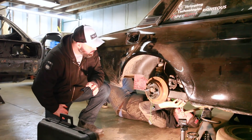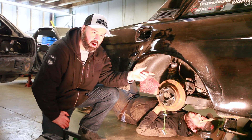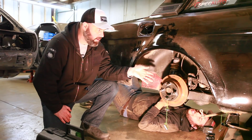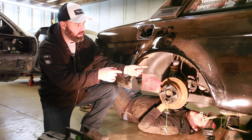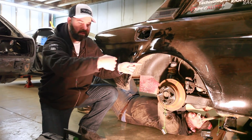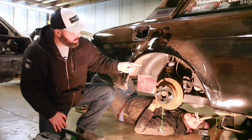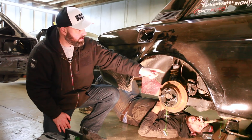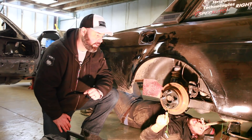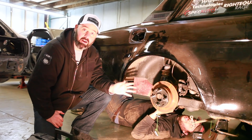The spring used to live in the spring pocket, and now it's converted to a coilover setup where the shock was. The stock setup would have the spring on the semi-trailing arm normally; now it's on the shock itself but the geometry is all original. It's got the original semi-trailing arm with two pivot points that attach to the chassis. Your inner pivot point for measurement purposes is a line through those two pivot points, and off that axis you draw a line to the centerline of the spring on the damper, then out to the center of the hub.